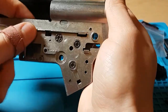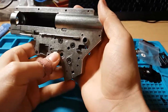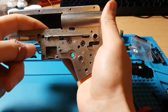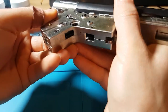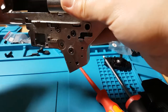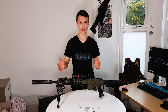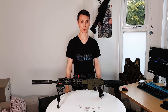After you finish with the gears and you're happy with it, install all the gears into the gearbox, screw it, and check if everything is working properly. One way to see if it is good is to install all three gears without anything else. Unfortunately, this is a universal guide — your case will be slightly different. You'll need more shims or less shims than me. For any questions, leave a comment below and I'll try to help you as much as possible.